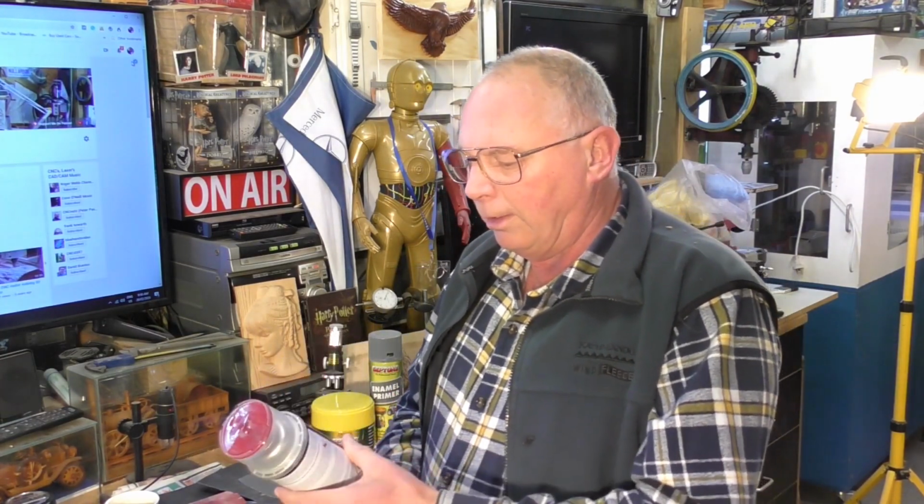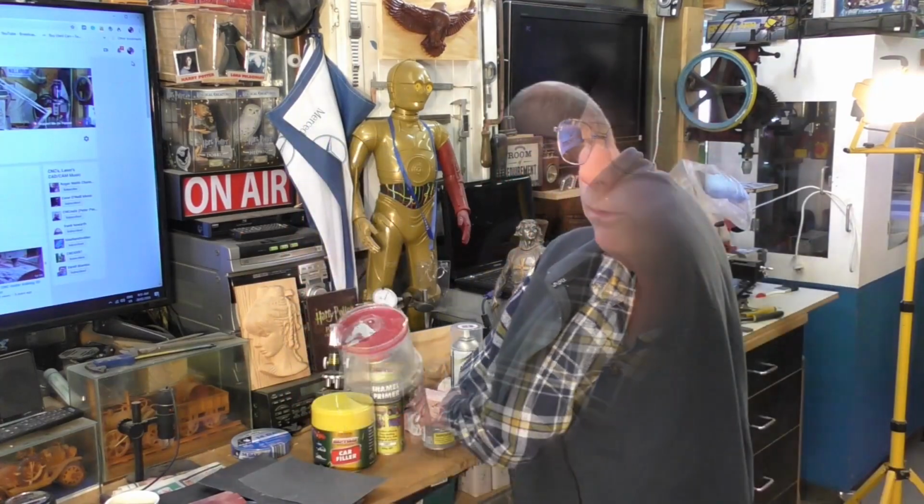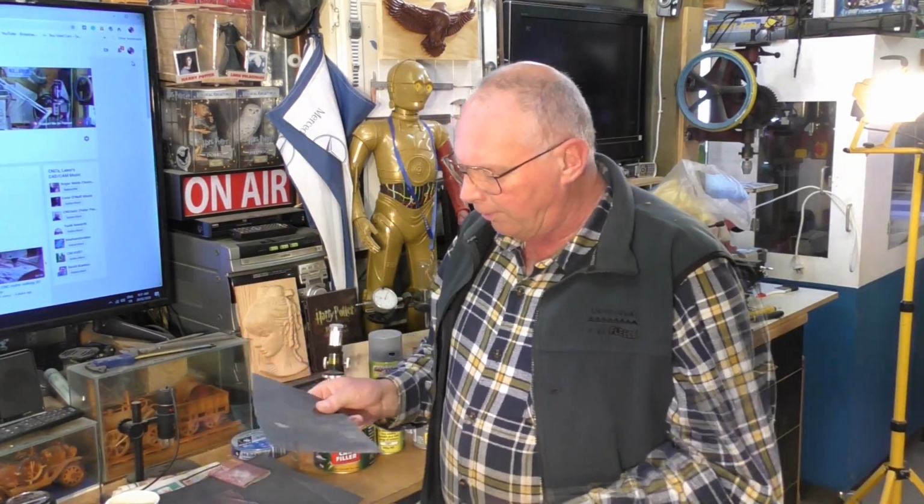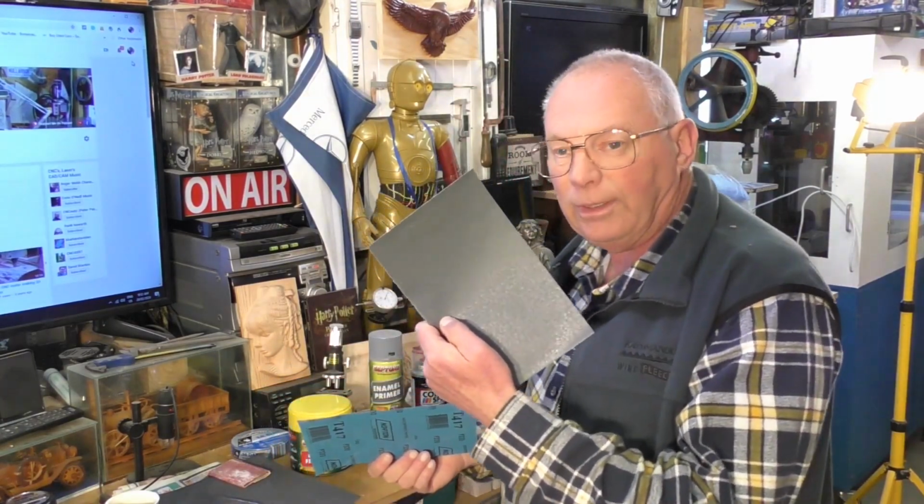I've got spray guns, but I'm going to do it not necessarily the easy way, but the way that probably 90% of people would repair their cars, I suppose, with an aerosol can. And of course, now this is the clear top coat. Cars, especially in Australia, do need a clear coat that does protect the paint. You'll need an assortment of grades of paper, all the way up to 1500. You'll also need a good masking tape, because you need this to make a barrier between the good paintwork, or where you don't want paint to go, on the rest of your car.